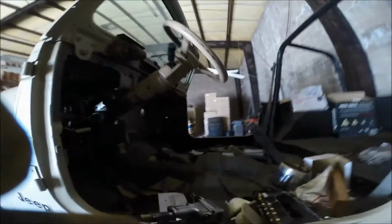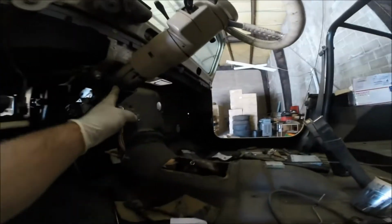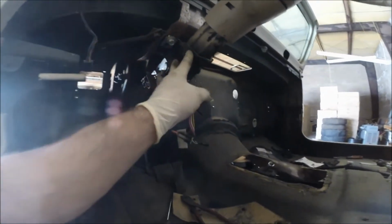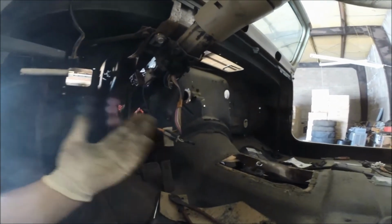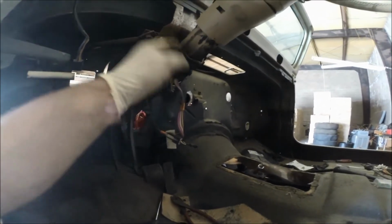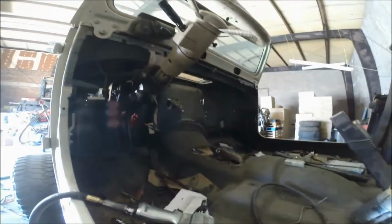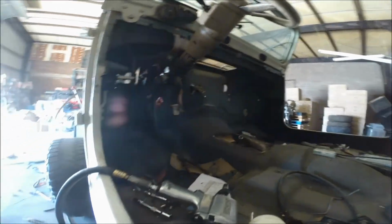So now you know that a Jeep Cherokee steering column, or I'm thinking now any GM that kind of looks the same, measure from here to the end and make sure that your shaft slides. Measure the bolts to the end of it, make sure they're the same, so you can switch brackets off and get one off of anything else, a Cherokee or an old GM.